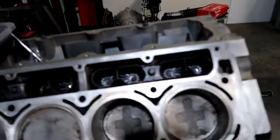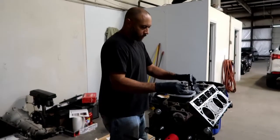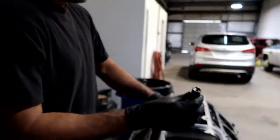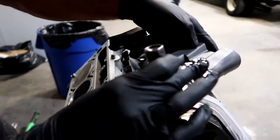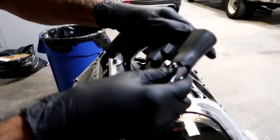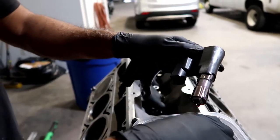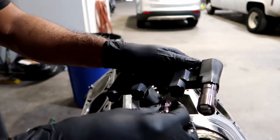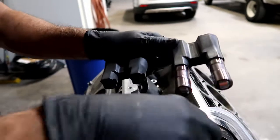The lifters have been soaking in oil here for about three or four hours. These are the LS7 style that I got. If you want to come over here real quick - this is pretty easy. You'll see the flat sides right here, and they'll match up with the flat part on the trays, and you just pop them in like that. And if you're worried about making a mess, make sure you've got something under you - cardboard or metal or something - so you don't get this all over your floor.